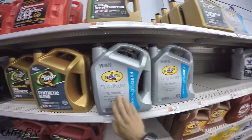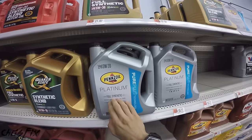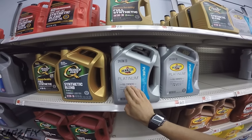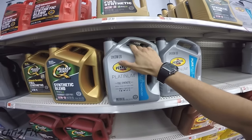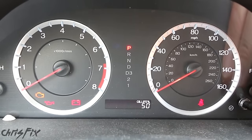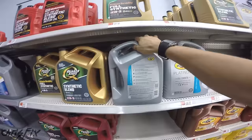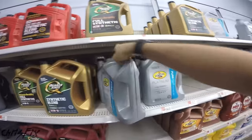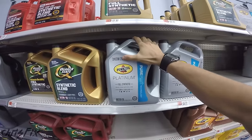There are a lot of myths out there on switching to synthetic. Just so that you know, you can switch to synthetic and you can switch back to conventional at any time. Conventional is cheaper, but on most new cars you need to run synthetic. Plus synthetic oil lasts longer. Change your oil at the recommended mileage listed in the owner's manual. Many cars have an oil life monitor that'll tell you when you need to change your oil. If you can't find any information, I change the oil in my cars at around 5,000 miles. My van has over 300,000 miles and she's still running great.